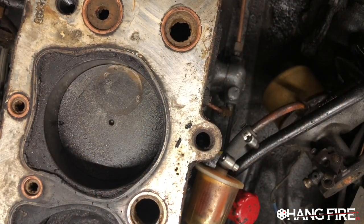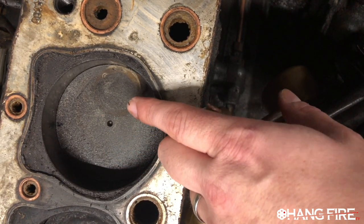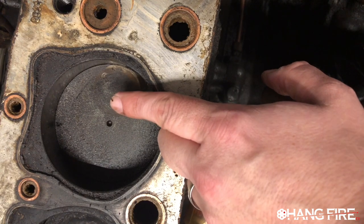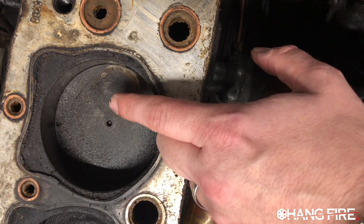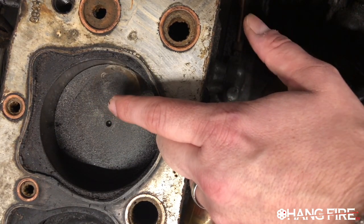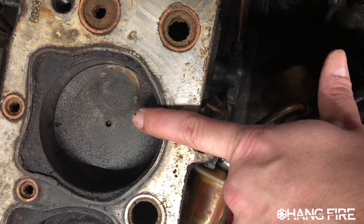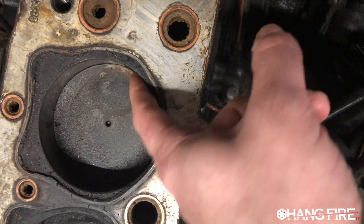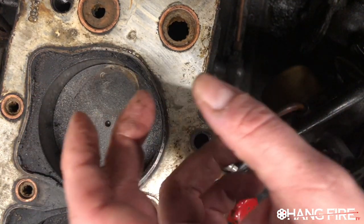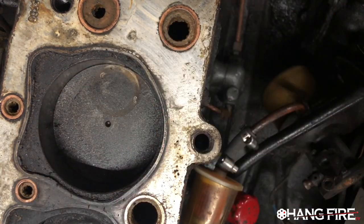So now we're looking right over top of the motor, and what we can see is that down on the inside of that, the only thing that happened when that failed is that all we really did was wear off a little copper. Yeah, we wore off just the carbon ring from the top of the cylinder. Cylinder walls are in great shape. There's nothing down here. I turned this over right as it sits. There's no edges down here. These walls are nice and smooth. So everything that we have here is really in good shape. We're going to pull some oil out of it, make sure we don't have any copper in there. But this thing's going to be good to go.